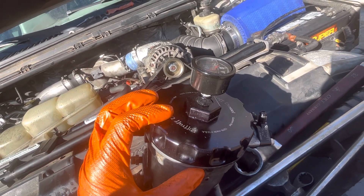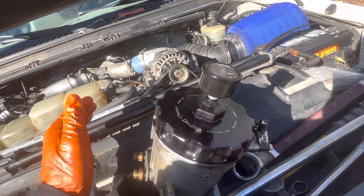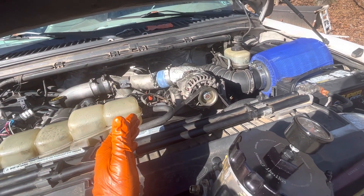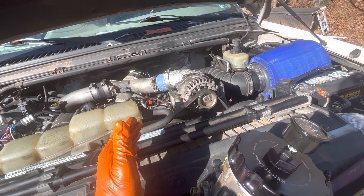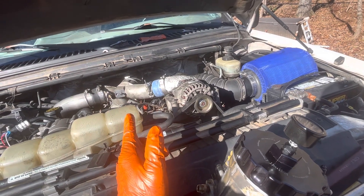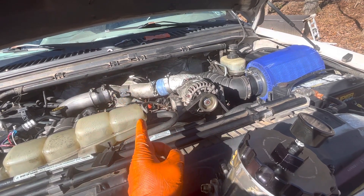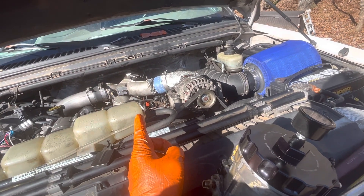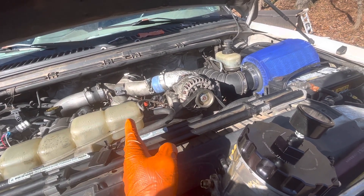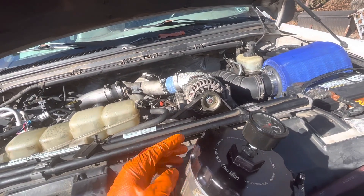Because this is a service truck and because I like doing things a little bit different, I'm kind of going overkill on this. We do have some other mods done to it — nothing crazy, all for reliability and durability purposes. We have 351,000 miles on it right now. I think we're going to do some fun stuff with the turbo — replace all the intercooler boots, probably a T500 HPO pump, replace all the lines, and then do a regulated return system for the fuel system. That should really make this truck very happy and give us hopefully years and years of service.